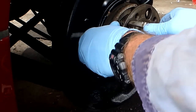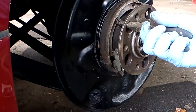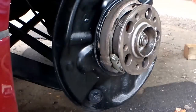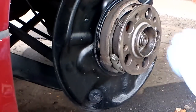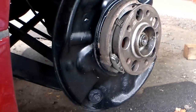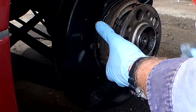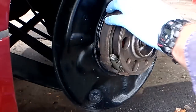Push through, making sure it's lined up, then turn one quarter turn and release — and they're locked on. Make sure the shoe is touching the metal stopper. Then slide the spreader into there. Do the same with the bottom shoe — pop it on, grab the spring, pop it into the spreader, push through and turn. Now we're not going to worry about the back spring yet because the front spring has to get hooked up first — that's the trickiest part of the whole thing.